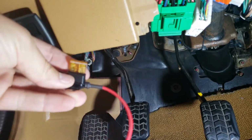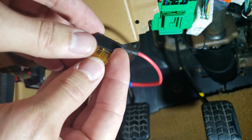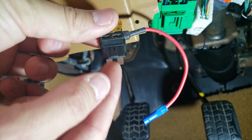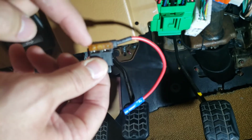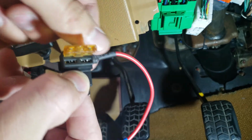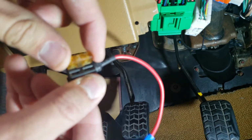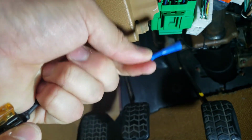And what I've purchased to hook up to this is an easy circuit adder. So you plug this in where your existing fuse is, take the existing fuse and plug it in on this side, and then this top row shares a power lead. It goes through another fuse that you can pull out, and you can hook up your gauge or whatever into this end.